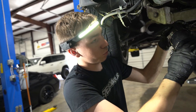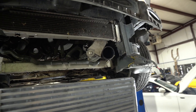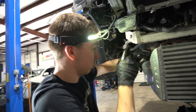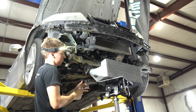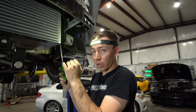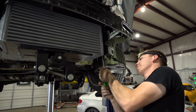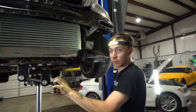The easiest way to do this is put this boot on the intercooler and leave the other boot attached to the other pipe, so you'll stab this one in and stab that one on. This boot on the intercooler, that boot on the rest of the charge pipe — that should theoretically work out. Once you get it up in there, they supply you with two Phillips screws — they're very long, so get a big Phillips driver and it's gonna take both hands. Just like that, the intercooler shouldn't fall out of the car.